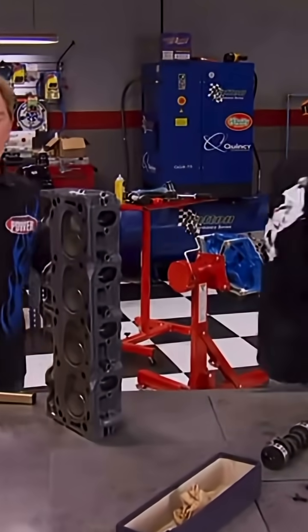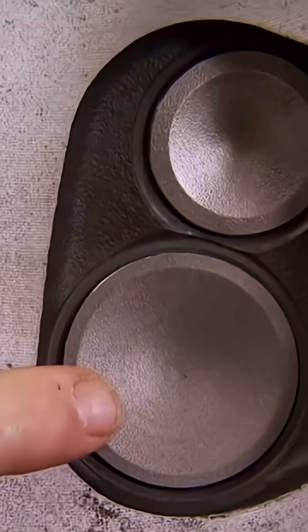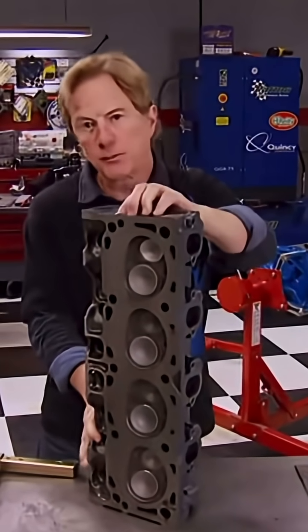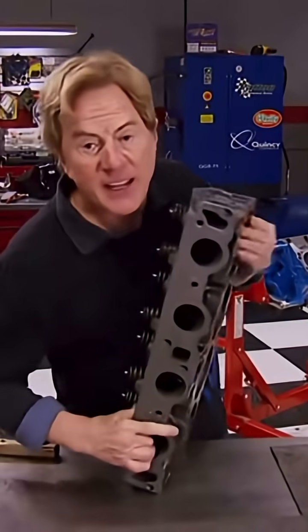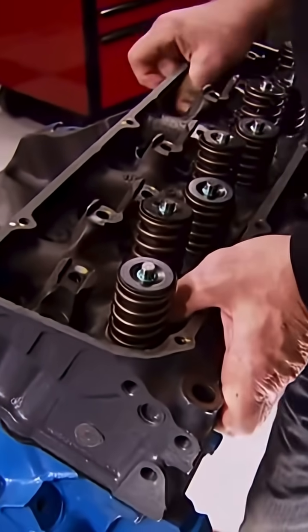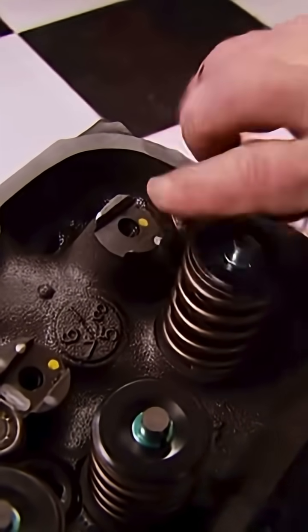Now, in case you're keeping score, the specs on the valves of these stock heads measure out at 206 on the intake, 165 on the exhaust side. We can also tell you that the combustion chambers measure 88 cc's, and since they're cast iron, they are ridiculously heavy. Felpro gaskets on a budget build, you bet. Don't cut corners here unless you want to blow a head gasket.